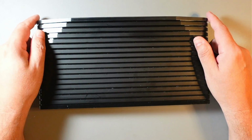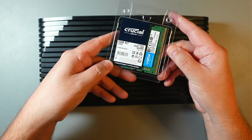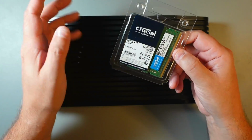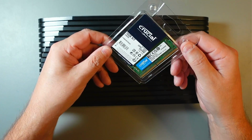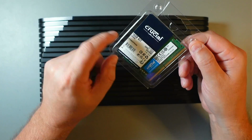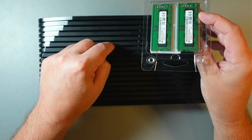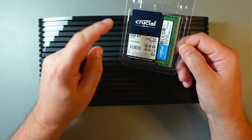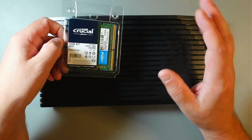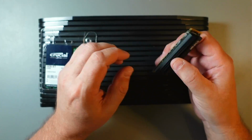So to do the upgrades, I'll be installing or replacing RAM. This is a 16 gig kit. I'll put all the links in the description, by the way. This is 3200 megahertz, so slightly faster than the internal RAM. So that should help a little bit with the performance, and we'll need to tweak the BIOS to do that, which we'll do.